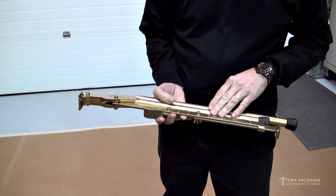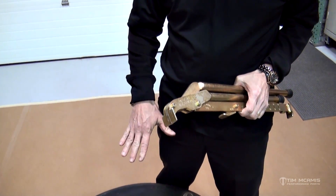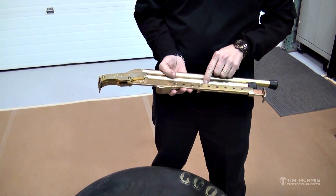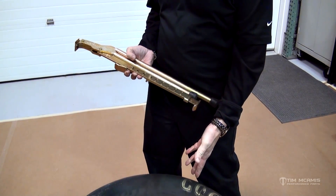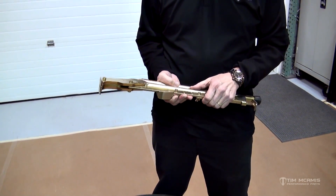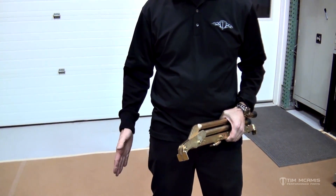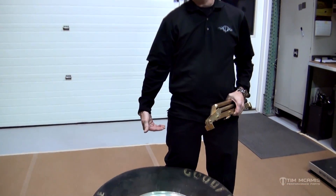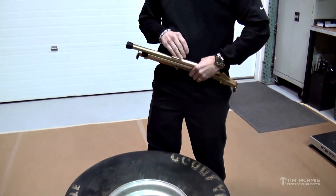Because of the shape of a drag racing tire and wheel, there's a lot more bulge past the rim. So based on these numbers here, if you go a little smaller than the actual rim width — for instance, this is a 15-inch rim and I'm going to put this in the 14-inch hole — it's a little easier to start, because a stock tire and wheel package like off of your car or truck doesn't have near the bulge in the sidewall, so it's much easier to get under the lip of that rim.